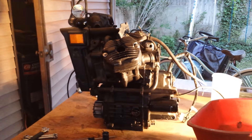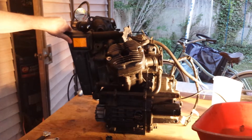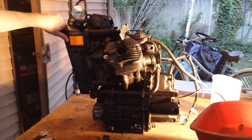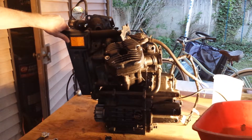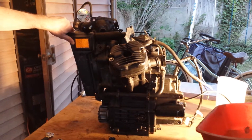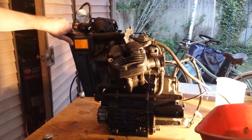What I'm working on is my CX-500 — it's a 1979 CX-500 Custom. The problem I'm having is there is coolant in my oil. What I have done is replaced the mechanical seal, and there's nothing leaking out of the weep hole.